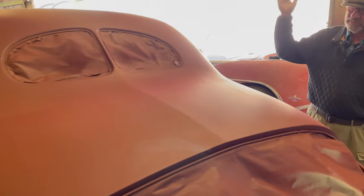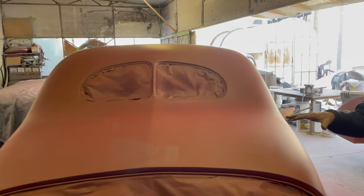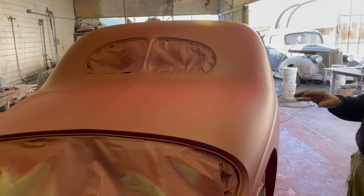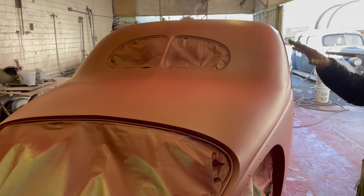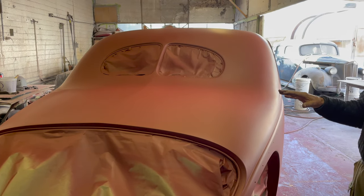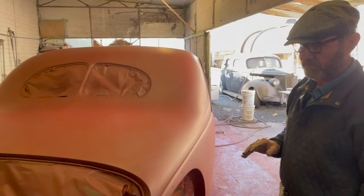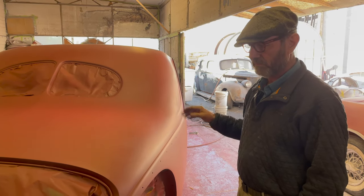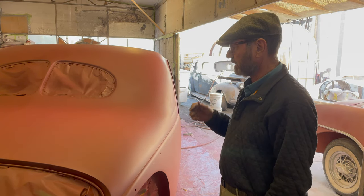And that sun is what's beating down on that clear color and showing you what's below it. So we definitely have to use a red primer for red paint. You have to use the appropriate primer. There are a number of different colored primers now that you can use to achieve that goal because the paint is so translucent. It's necessary to have that regardless of what color you pick.